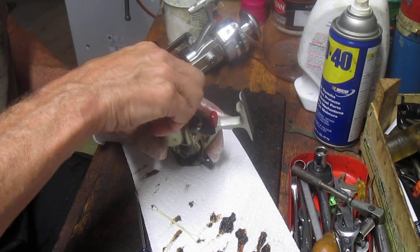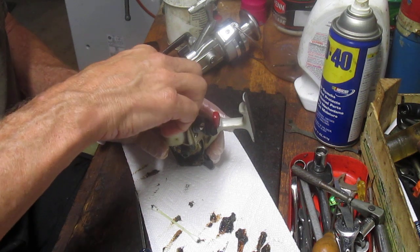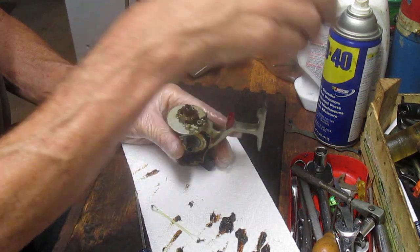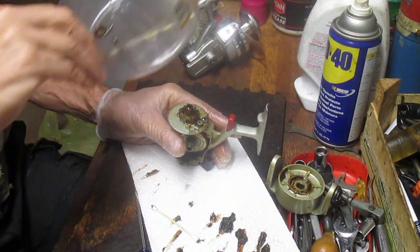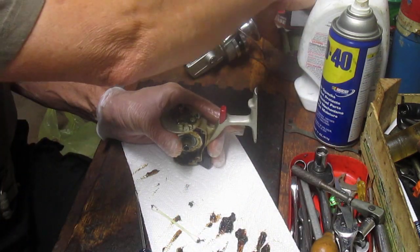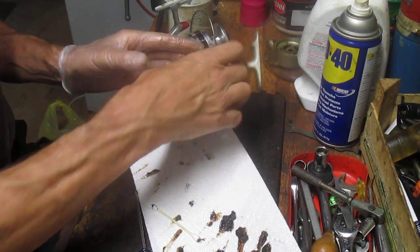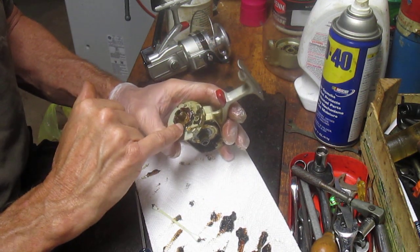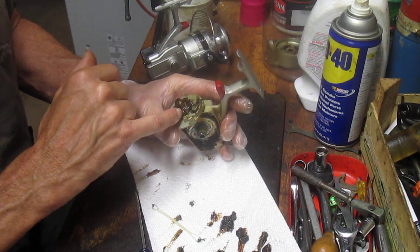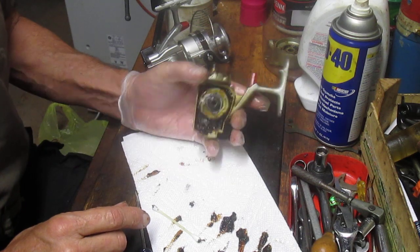Just going to pull that rotor just to see what we have underneath here. I also need to pull it because I'm going to grab that pinion gear. And as you notice, I'm putting these off into a parts tray. And I think we just found the reason why we don't hear that operational click: there's so much grease on here that it's just not working. Actually, it looks like it broke the spring off of this one. The dog is gone. So that's what happened here.